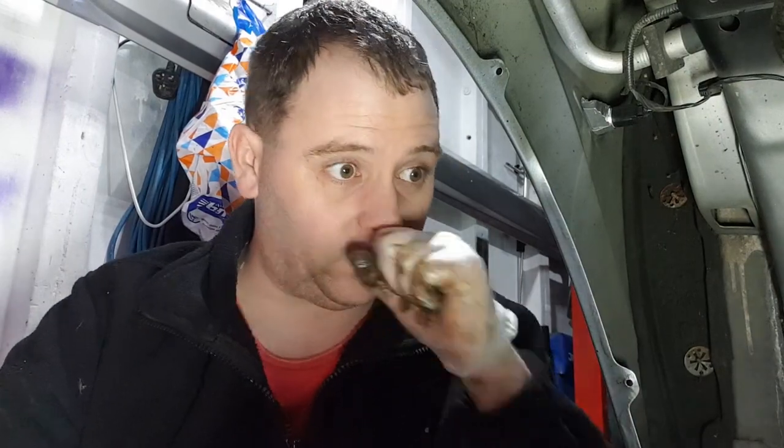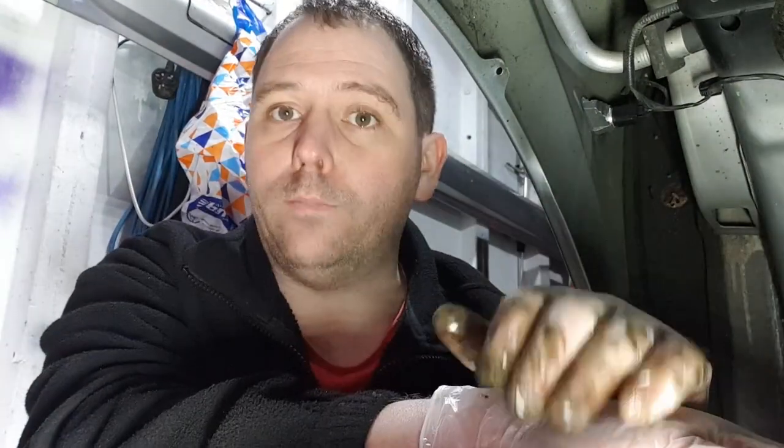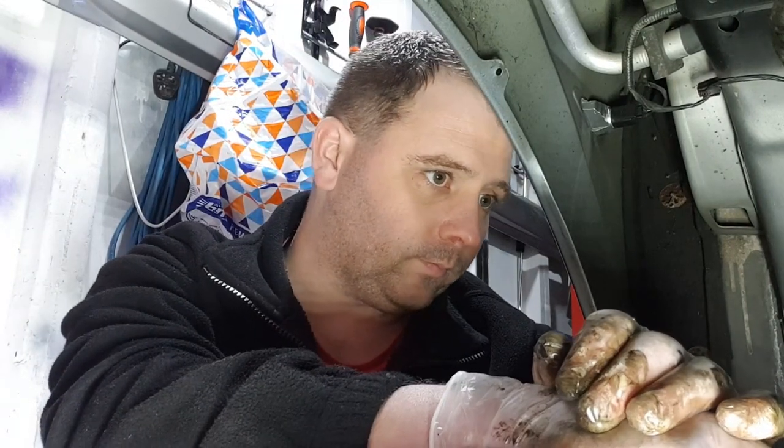And go from there. But this one is just a quick video to show you. I made a boo-boo, where I yanked it out too much, popped the CV boot, and all the grease went everywhere. So my mistake. Quick and easy fix. It lost some grease, so I've repacked it with some grease, given it a good clean, put it back. So I'm gonna have to nip out now and get some bigger cable ties. And in fact, I'll have a little butcher's in my toolkit and see what I've got. But for now, hopefully instead of replacing the whole thing, if your boot is okay on these things, you can just clean them up and repack them with some CV molybdenum grease. It's a mouthful.